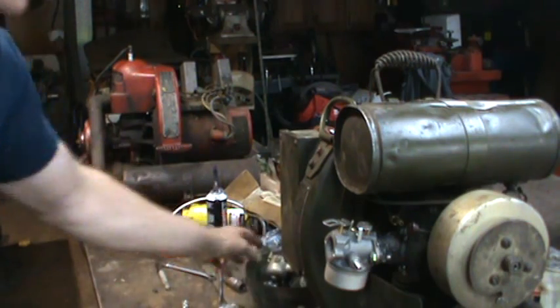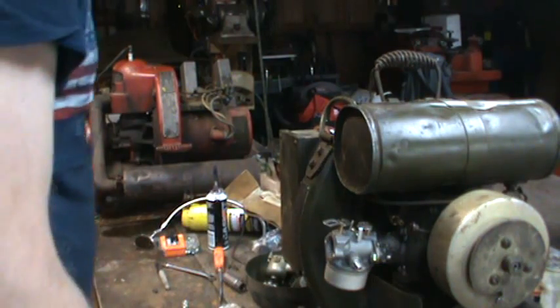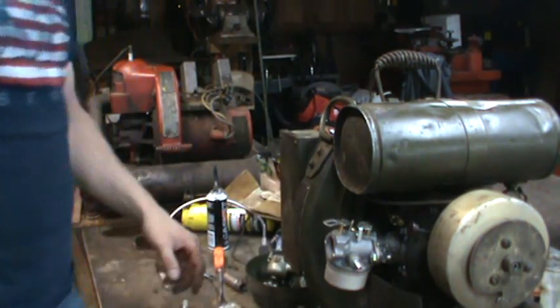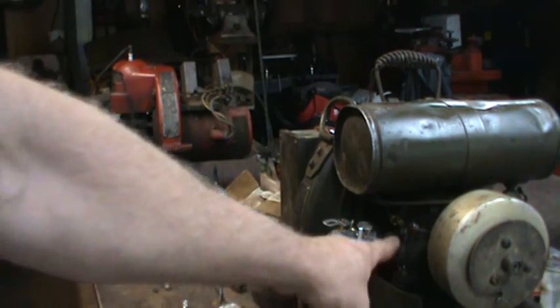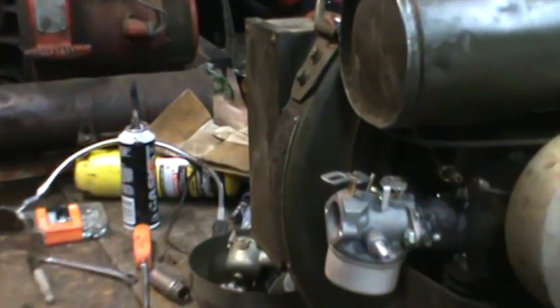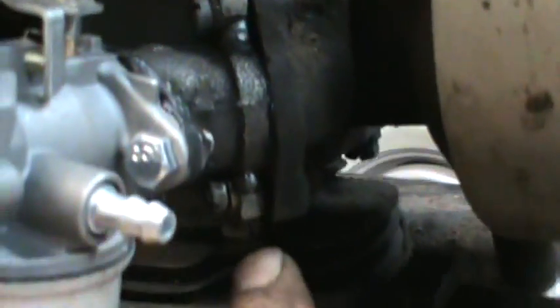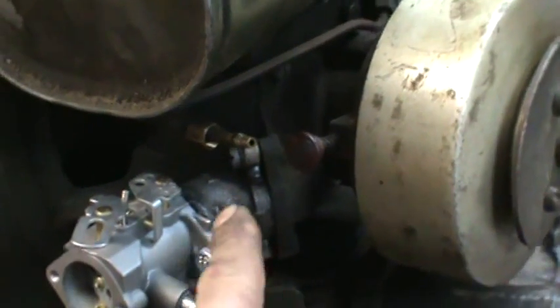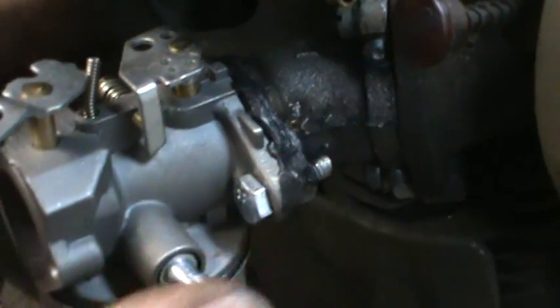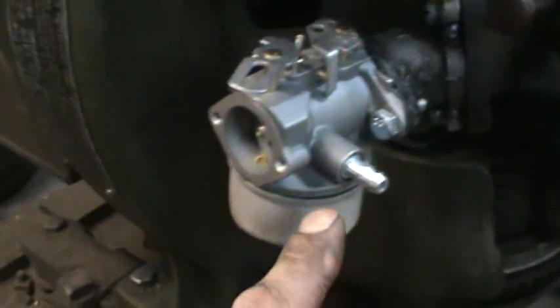What I did is just kind of quickly cobbled together — this is just a piece of angle iron flange and a 45-degree elbow, and I just welded a couple of nuts on it. It has just a couple of nuts welded on there, and I took some sealer and ran it across, then did the same thing on the other side — two nuts welded on it and then some sealer wrapped around it.